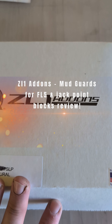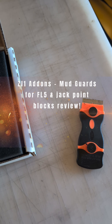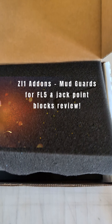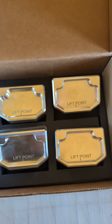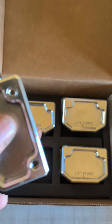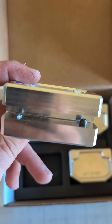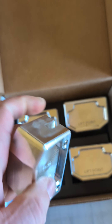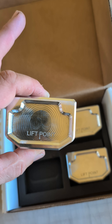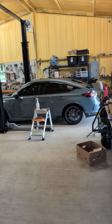First box right here is the add-ons - these are the pinch point lifting blocks that I bought. Really nice billet machined, shows you where the lift point is. These are what you put on your car where the pinch weld is, but you can put them next to the pinch welds so you can still use your pinch welds to set jack stands on, and this will add a strong point for lifting. In my case, my lift over here...